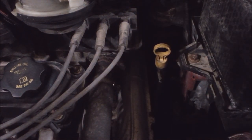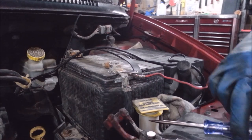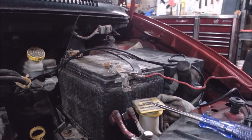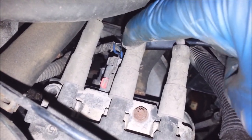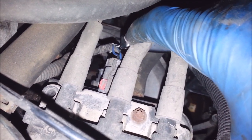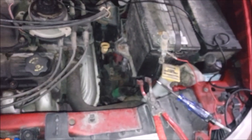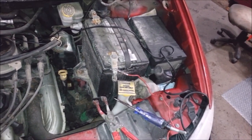Now that it's missing, I'm gonna recheck. Well, it's not missing now — now it's working. Cylinders two and five — this coil right here wasn't getting a spark when it was misfiring. That would be this tan-and-blue wire all the way on the left. I T-pinned it and checked it. Now it's not misfiring and it's pulsing. I'm going to try to get it to misfire again, and if it doesn't pull a signal then I know it's a computer problem and not a coil problem.